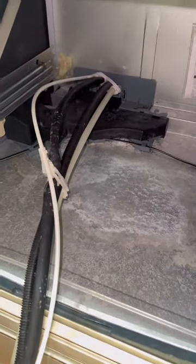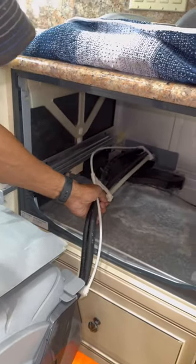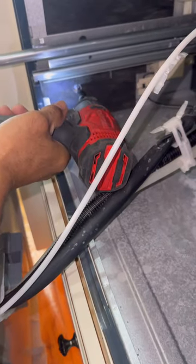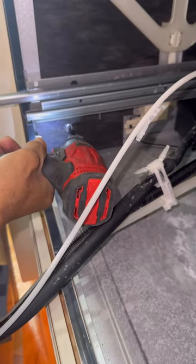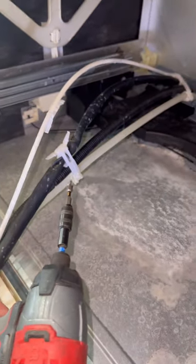After this cage is removed, you're gonna have your power cord back there. And then you can just extract the entire unit. You gotta slowly fish your water lines out, and that's how you're gonna take it out. All right. And just for reference, this is where the screws are. And that's just gonna be Phillips. And of course, one is way back there, so you have an idea.